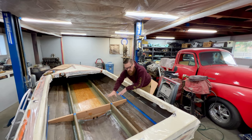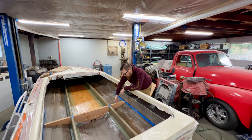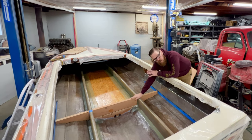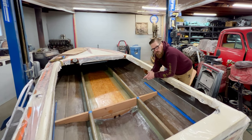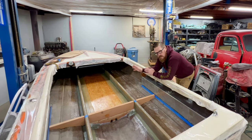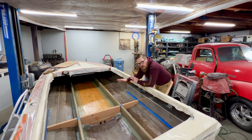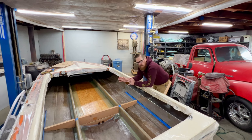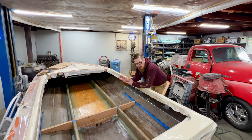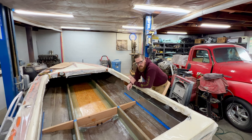In addition, I'll have a finished engine box that will be isolated from the rest of the boat. On top of that, this is the back edge of the seat, so I'm also going to be able to use these lateral supports and this board to help bolt the seat in rather than only relying on the stringers. Now my fiberglass is actually dry on the center of the floor, so I need to stop here and go ahead and start working on the bulkheads. My placement of further lateral supports up in the boat is going to be dictated by the placement of all the bulkheads, and they all kind of play off one another.